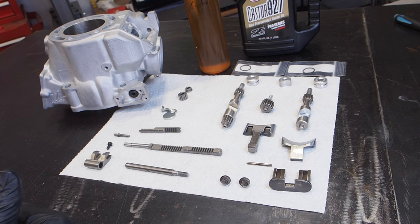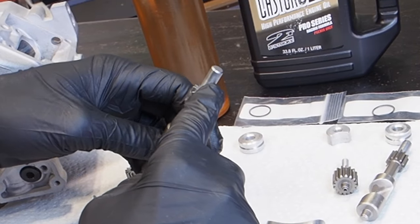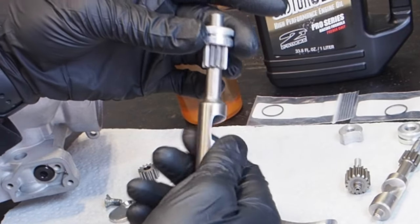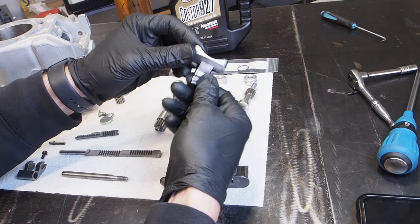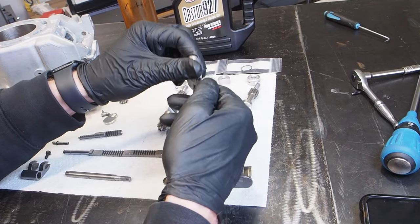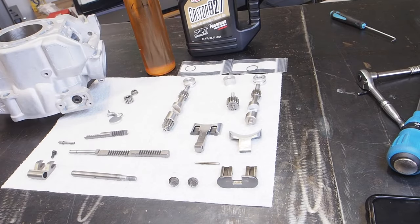Make sure all carbon pieces are clean before reassembly — I'll leave a link in the description showing the process of cleaning exhaust valves. You also want to remove any burrs on the tips of the sub exhaust valves so the valve guides slide on easily and rotate smoothly. You can also clean up and polish the main exhaust valves too — that makes carbon stick less to them and flow out of the cylinder more efficiently.